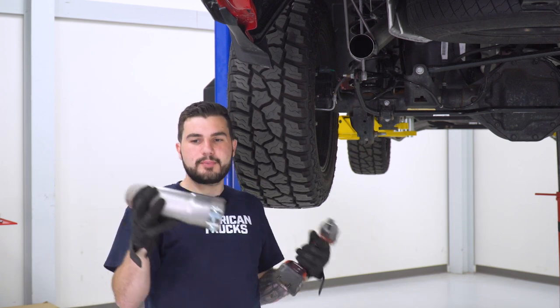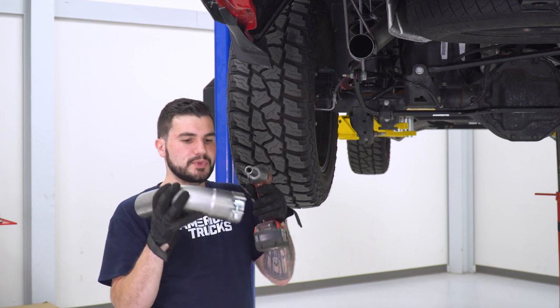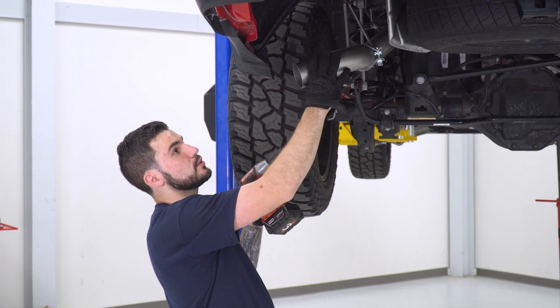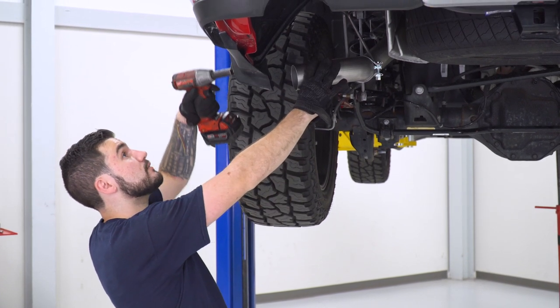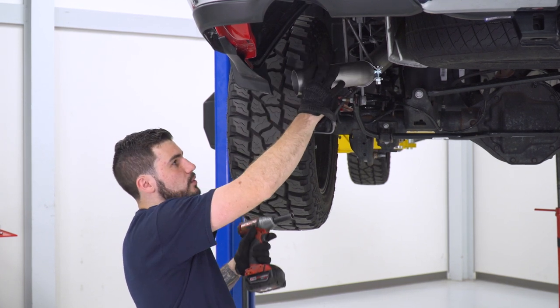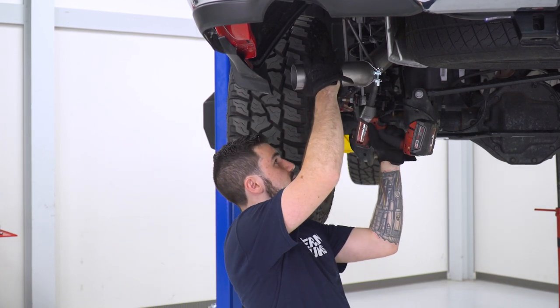First, you want to take your exit style pipe, which is basically a 90 degree elbow. Make sure there's a clamp on the end. Install that on one side. Now, when you tighten this down, you want to make sure it's angled right underneath of the rear fender and rear bumper. If it's angled up too high, your tip will go straight inside and that won't work. So just have it low enough and then tighten down your clamp.